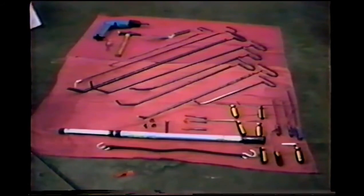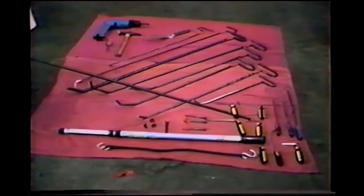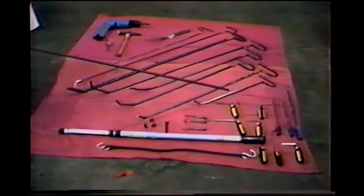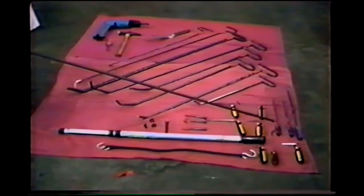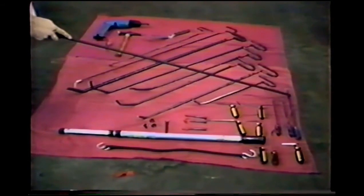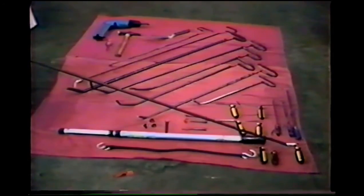You can get started in your dent work with a tapper, one screwdriver, and a light that you can adjust. Here's kind of an example of what a professional dent man might have for his more complete toolkit. You'll notice the different lengths of screwdrivers and the different thicknesses of the screwdrivers. The angled screwdriver, a longer screwdriver with a non-90 degree angle right here. We have the thin screwdrivers with the angled ends, the very long screwdriver with the 90 degree end, the screwdriver that's bent so we can put it through the holes in the handle and get extra leverage.